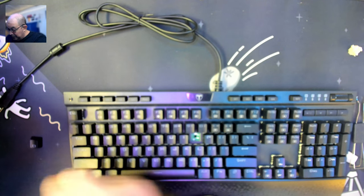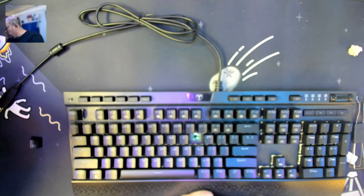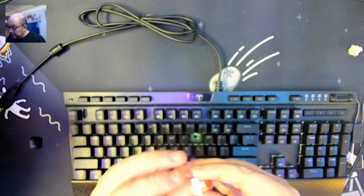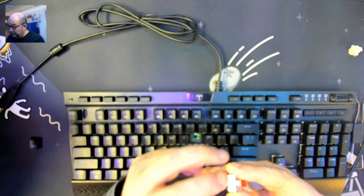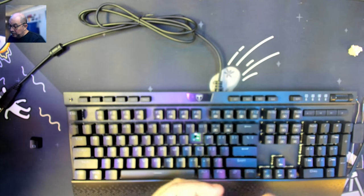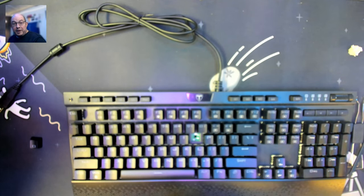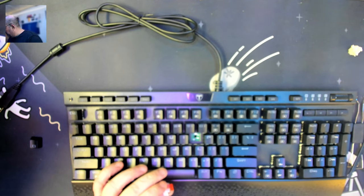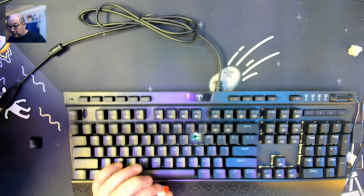But at least you can take out the stock switches, or if you do want to replace them, there are the Akkos that are wing latch, meaning they have this one flat piece on either side instead of the four legs. Those are manufactured by, I believe, KTT, and do fit into these. But if they have four legs, they're not gonna work. I believe those are the ones manufactured by Gaterons, but don't quote me. That's just things that I've read online.